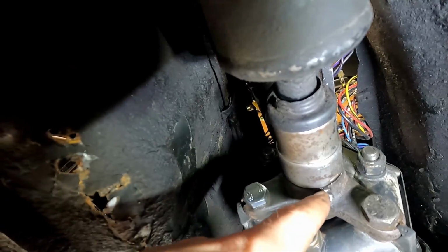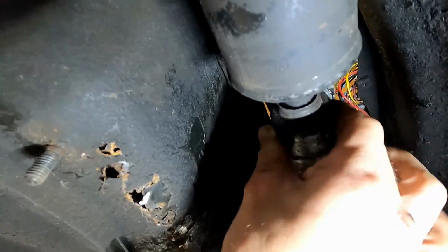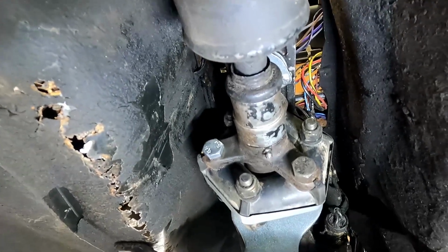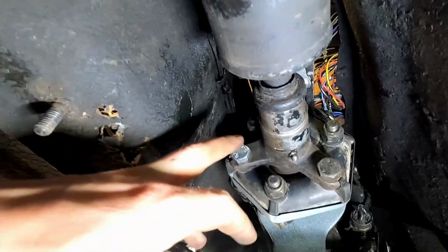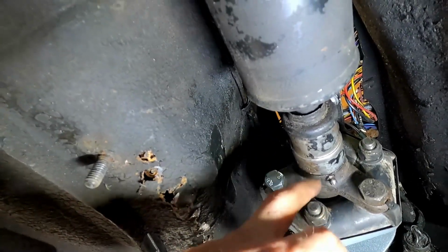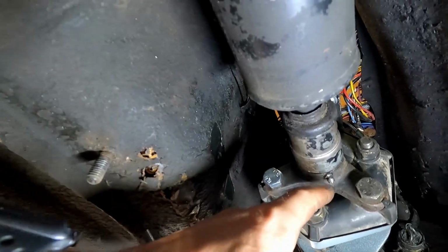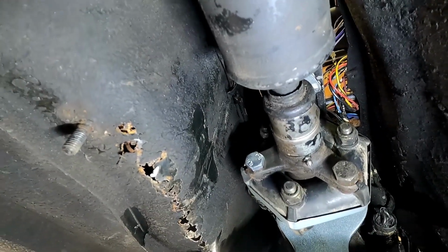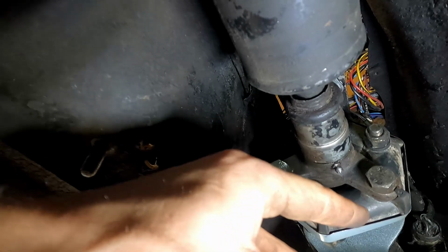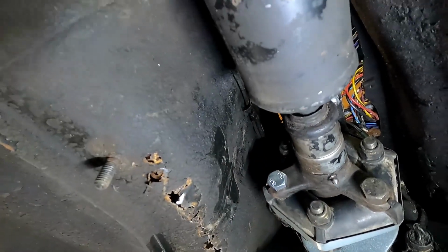We're going to get our grease gun, we're going to fill this up with grease. Maybe we'll see it come out the back a little bit, but I want to make sure this is nice and full. We'll see if we can get this outer casing. Yeah, we'll turn this outer casing to get that grease turned around in there. And then once we get this thing running and driving, which hopefully will be soon, within the next few weeks at this open house at Vick Auto, we'll be able to come back through after a few road trips around the block, which I'm really hoping is going to happen, and we'll top that off and make sure it's really lubricated. We did put lube on the splines as we were fitting it on there, so there is some in there, so it's not just dry, but more the merrier. You can never have too much.